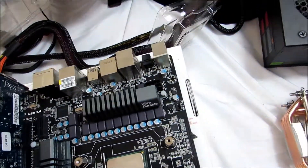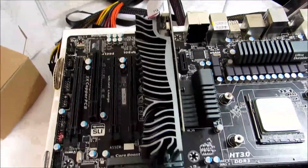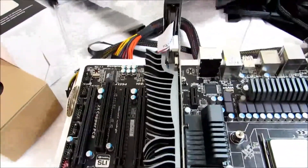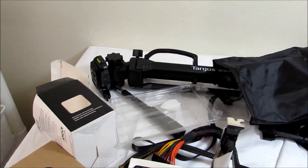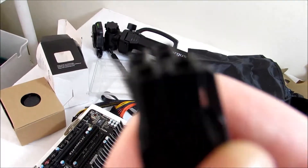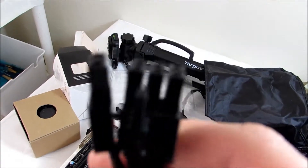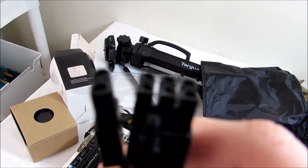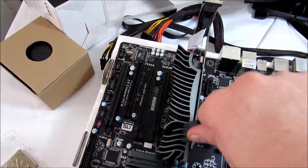As you can see, it's not going anywhere. And since this graphics card is so old, it does not need an external power connection. But most of the time for your graphics cards, you will have external PCIe power that runs from your power supply, either an 8-pin or a 6-pin. In this case, this is an 8-pin that you can make into a 6-pin, and it would run into the top of the power supply, either 1 or 2.